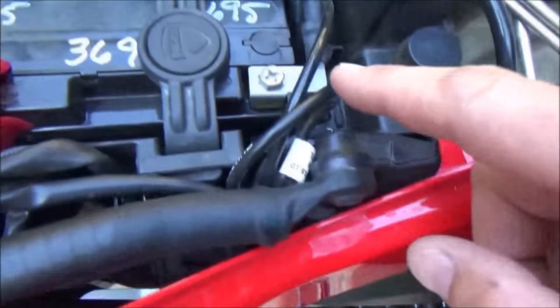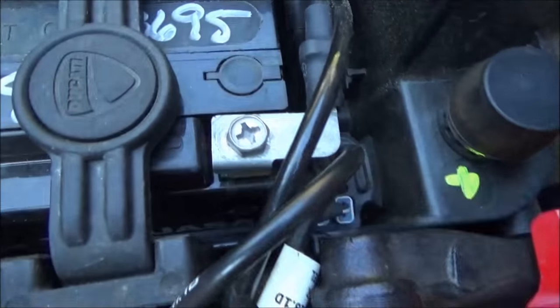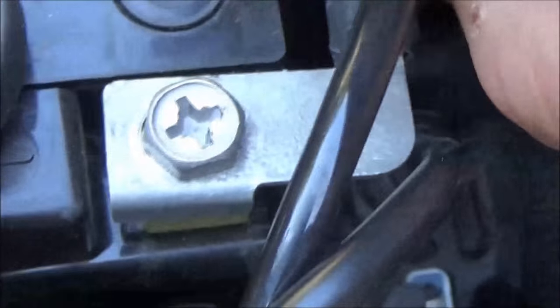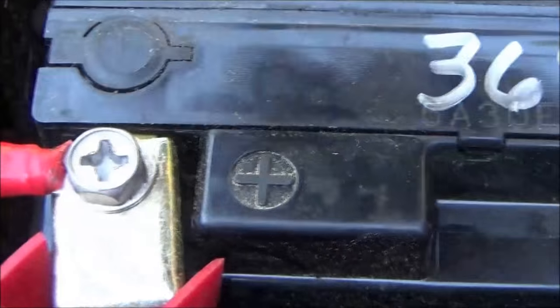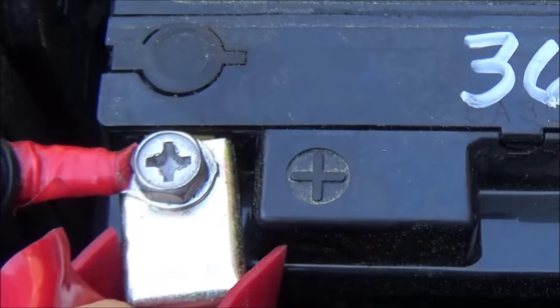Let's start by getting the seats off. One of the first things I noticed is I'm not crazy about this battery cable — the negative battery cable has no washer under it. Standard practice calls for a washer there. Without it, vibration will probably cause it to come loose. Over on the positive, the ring terminal is secure and not moving around.